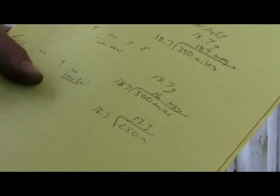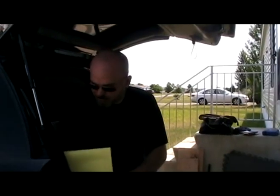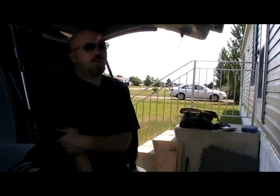And that was like 2008 or so when gas started to really get up over 3 and everybody was panicking. Although 3 would be like a luxury now. But I knew there was a problem. And one of the things that I never did in the truck was actually replace that stupid gas filter. Well, when I took it off, that thing was like a brick. It had a lot more weight than that one did. I didn't do anything else. I didn't reset fuel trims, did nothing with the PCM, put on a new filter, and instantly everything was restored.